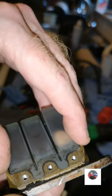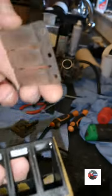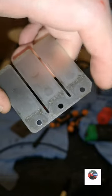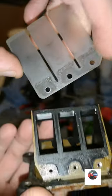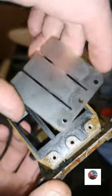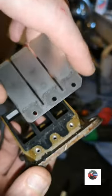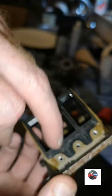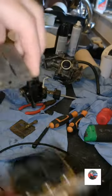So we're gonna clean these petals. The petals. We do have a little cutout on the top. That goes on a special way, I cannot remember now. So I've not done reeds for a while, but I'll look it up and find the special way to put them on. But I will be Loctiting them screws before I put them back in, the three little screws.